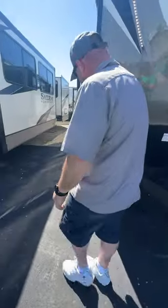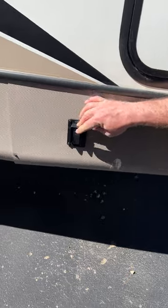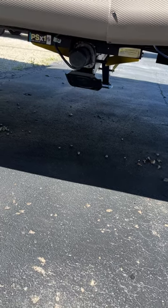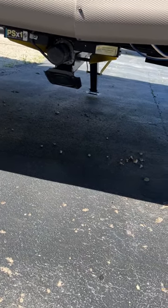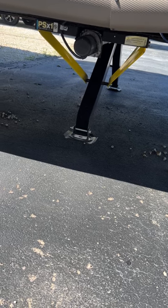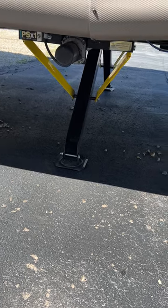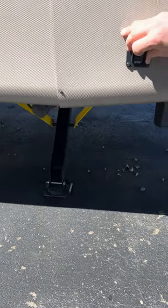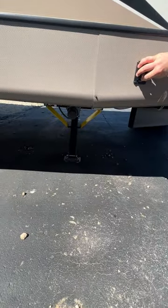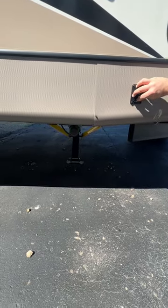Here, we'll go ahead and show you the front one right here. You're going to have this one that controls the front jacks, and then you have one in the back that will control the rear. You've got your extend, and it usually will only bring down one at a time. Once the other one senses pressure, the other one will start going. Once they hit contact and start gaining pressure, you'll kind of hear that motor start to whine, telling you it doesn't have much more oomph in it. It's just meant for stabilizing the camper. Once we go around the coach, I'll show you where the rear one is located.